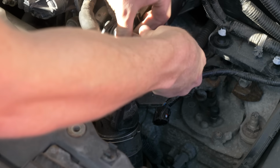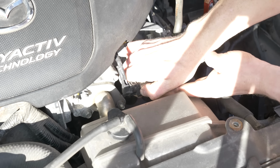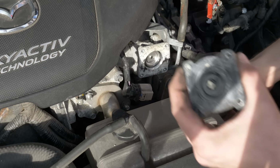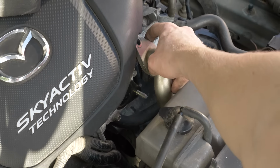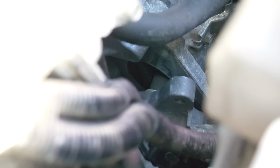This pipe off the intercooler had to come out of the way, and after a few more nuts and bolts to get it completely out, it's onto the EGR. So I removed the plug and these 4 bolts on the EGR valve, then got rid of this pipe, and I finally had access to the starter motor, but it was such a struggle getting this located under the car.